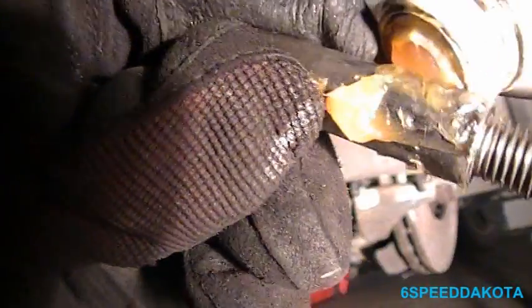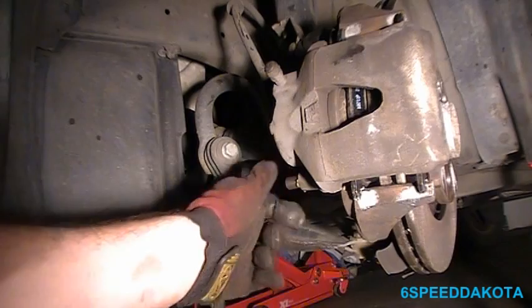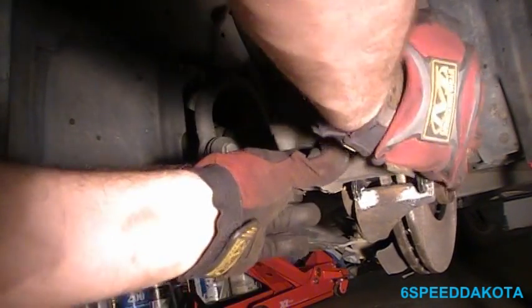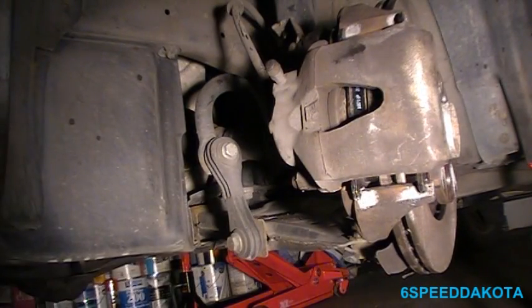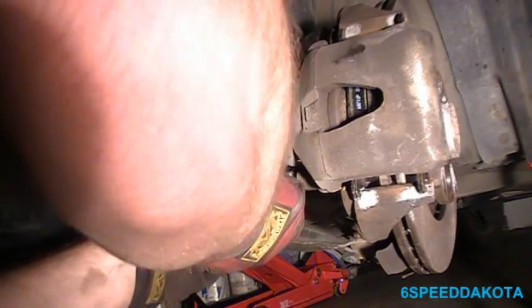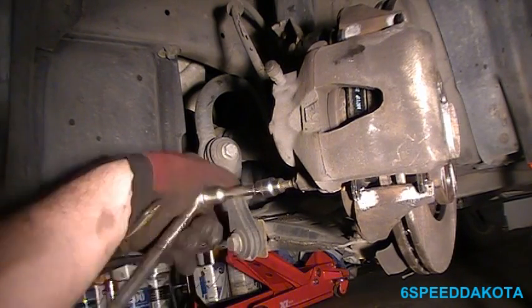Clean it off. And a little bit of grease in there. Again, push the caliper and move it around a little bit. And that should get, as you push on the back of the screw, that should get that lined up. Okay, and then we'll tighten this guy down. Of course, make sure your ratchet's tightened before you go wrenching anything down, or else you're going backwards.